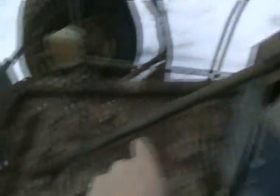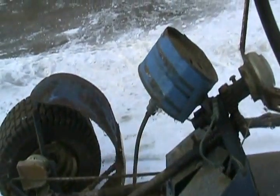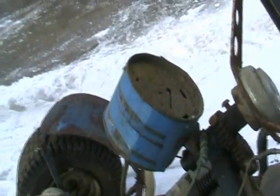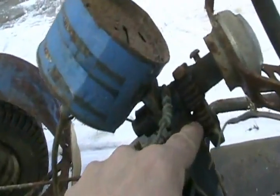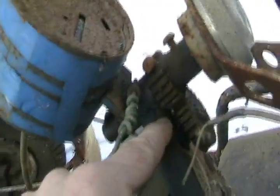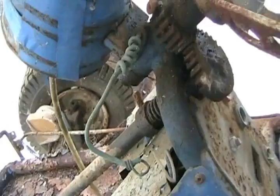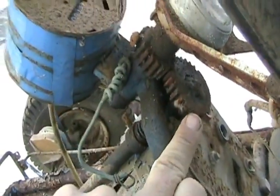It's got vibration dampeners in the steering shaft, upper and lower. I made a special little pickup that works off the axle with exactly the right calculated ratio to make that speedometer work, but that's destroyed now. I custom cut on an indexing head on a milling machine my own gears. See this one — I didn't even bother cutting the teeth all the way around; it wasn't necessary to give it a bit of ratio in the steering.